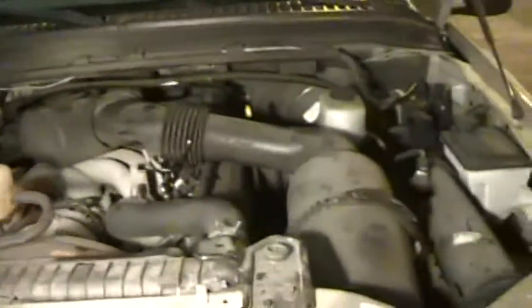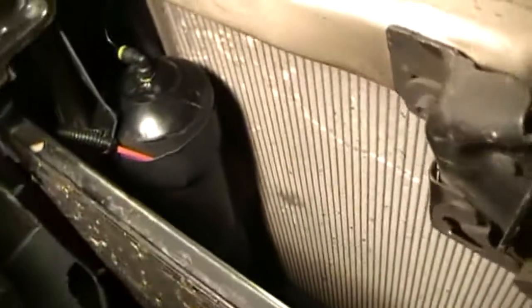It's Ryan again. I'm going to show you the generator that I just installed from Highline Hybrids. There wasn't a whole lot of room in this engine compartment, as you can tell, but I did find space. I removed the shroud that covers this area — I'll put it back on later — and found room in between the AC coil and the radiator.